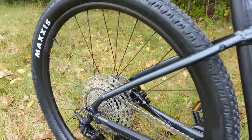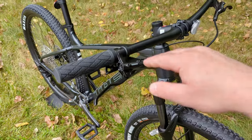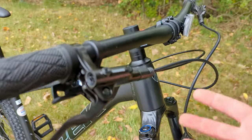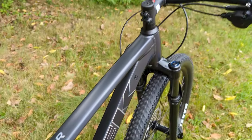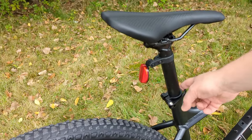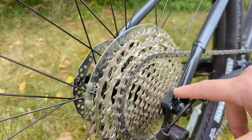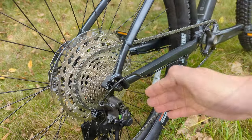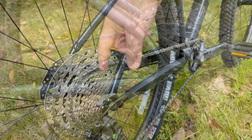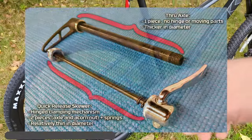This bike uses Trek's Alpha Gold Aluminum — shaped and manipulated tubing. It has internal cable routing, an inch-and-an-eighth to inch-and-a-half tapered head tube, a threaded bottom bracket for durability and serviceability, an integrated headset, and a 31.6mm seatpost diameter with internal routing for a dropper post. Out back, one of the more controversial aspects is that it runs Boost 141 — the quick-release variant of Boost, with no through axle. The 141mm over-locknut width is the same dimension as Boost 148, except 148 runs a through axle.